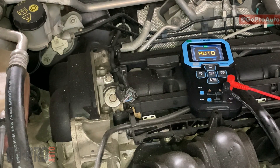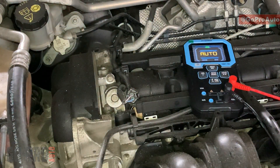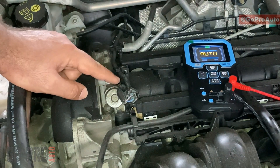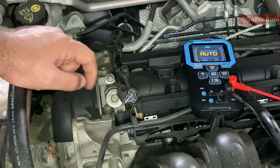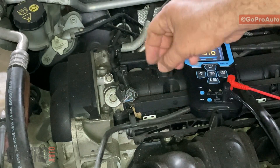If your fault code is not referring specifically to the solenoid valve but is instead referring to valve timing — for example P0011 or P0016, which refer to the timing system on the intake side — then in addition to what I'll cover in this video, you also need to remove and clean this solenoid valve. Over time, engine oil sludge can build up around it and block its passages. You can remove this solenoid valve and actuate it with a battery to verify it's working properly. Let's first go through checking the wiring and internal resistance.